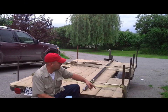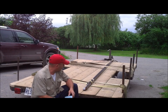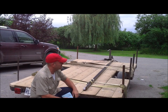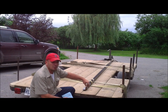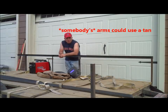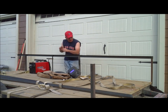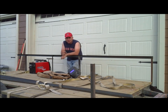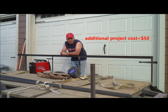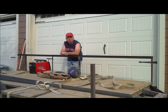Moving along at a steady clip now. We've got our stakes in place from the bed frame. I did have to go and spend a little coin — I dropped over $50 in materials. What I got here is 2-inch by 2-inch angle iron, 1/8-inch thick, same thickness as the stakes. We're going to go a little bigger on the rails, and I'll show you why in a minute. We're rounding the bend now, almost in the final stages of assembly on our sub-$500 trailer project. The last thing to do is get the two 12-foot 2-inch by 2-inch angle irons tied in for the rails. It's a really hot day out — going to be 90 degrees — I just want to get this thing done. Let's get it done.